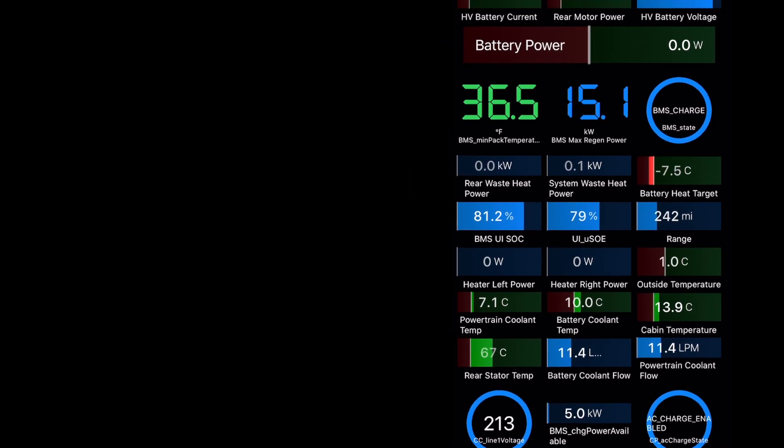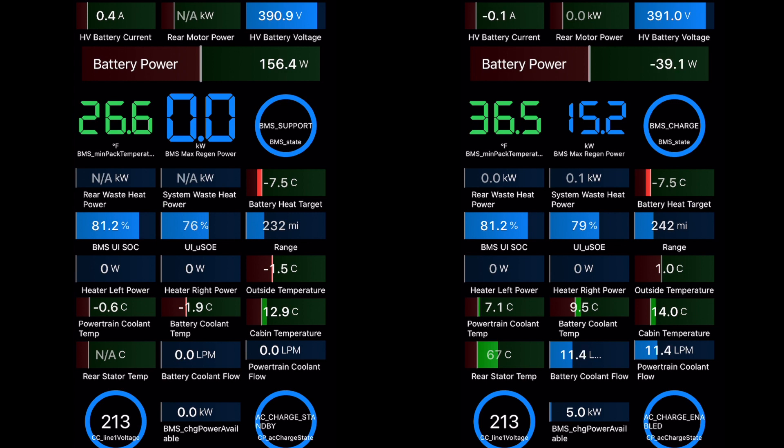Let's compare where we've gotten to where we started. We've raised the battery temperature by 10 degrees, added 15 kilowatts of regen power, and in about 10 minutes our state of charge has gone from 76% to 79%. The cabin's warmer — this is a car I'd much rather drive to work. Hopefully this gives you a little overview of what happens when you start charging or conditioning your car and how battery temperature affects other parts of the car. Looking at these signals and details definitely lets you see what's going on.